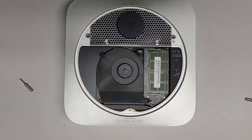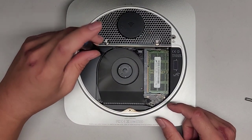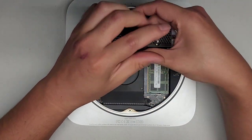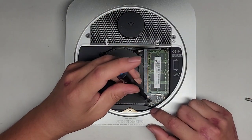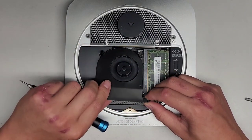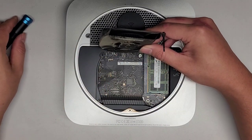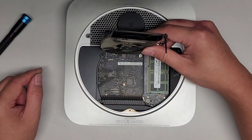A T5 is too wobbly, so we're going to use a T6 or Torx 6 screwdriver to remove the fan screws. Again, keep all the screws in order. These actually hold themselves to the fan as well, so you don't have to worry about losing them. Don't forget the one down in this corner. Now we've got all those screws out. You can see we can lift the fan up — you want to be careful because there's a cable attached underneath. There's still a lot of dust under here, so I'm going to have to clean this up.